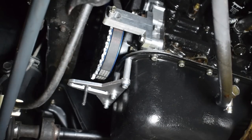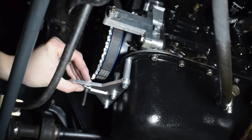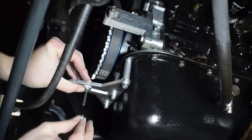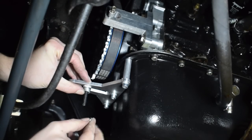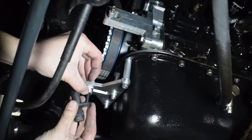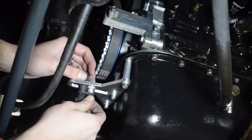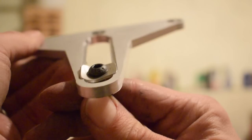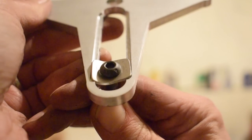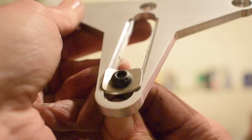Get the special square washers and put them in their indents on the top side of the bracket — they slide nicely in the rails but won't fall through. Get the black bolt, put it through the top washer, then get another square washer for the bottom side of the bracket. Add a number of little round standard washers — in my case I need five washers to get the perfect gap between my sensor and my trigger wheel teeth. Put your sensor on and finish with the provided nut.